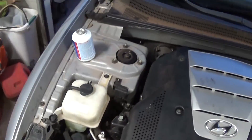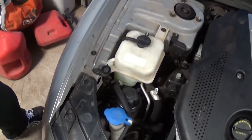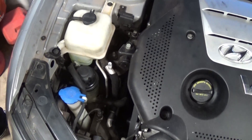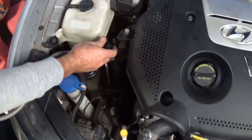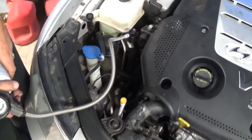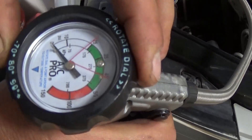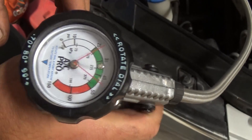It will be really handy if you have a scale so you can measure the can before and while you're adding refrigerant — that way you know exactly how much to put in. But you can eyeball it too. Do not overfill it. Most new vehicles have protection so it won't hurt the compressor — it'll shut off because of high pressure.